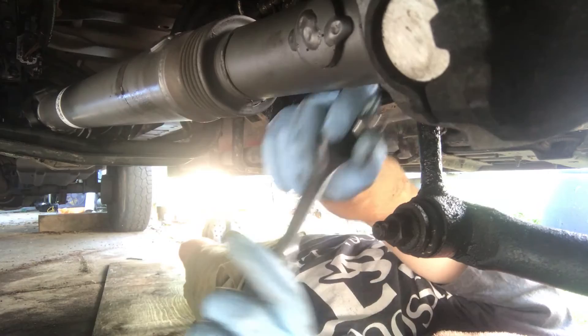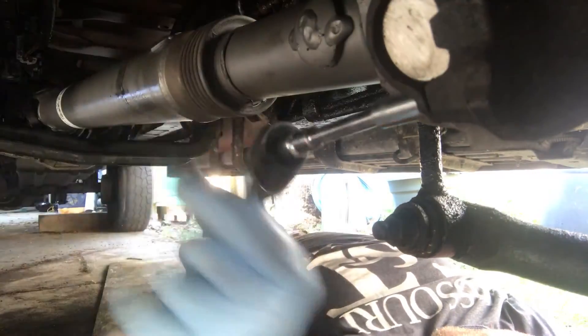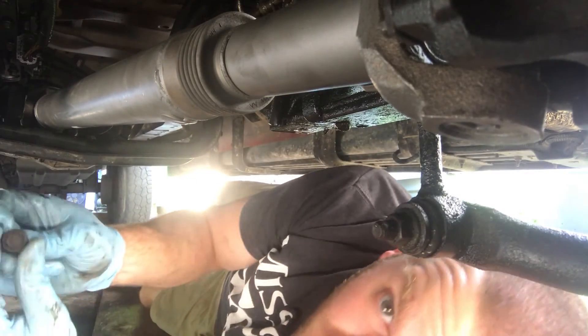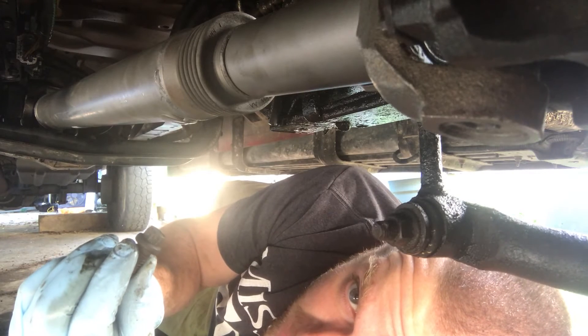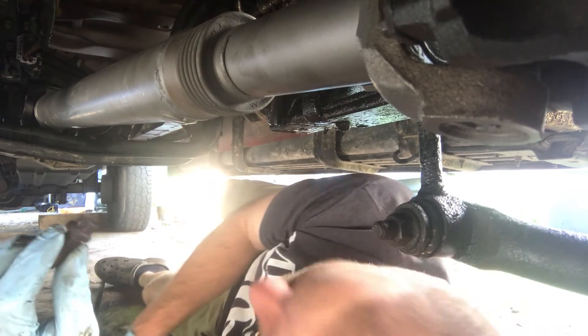She turns readily now — couldn't do that before. I'll have to go lock the truck in four-wheel drive or something. The back end is a 12mm, and you have to use a 12-point socket because it's this kind of little star-looking head. It actually works with a 12-point socket — a 6-point won't do it because a 6-point won't grab it right.